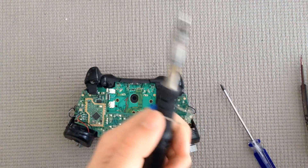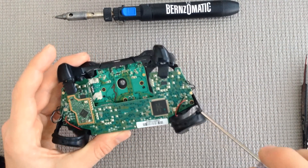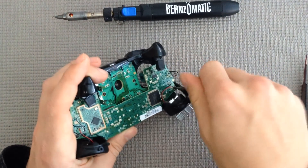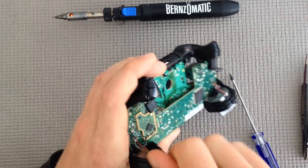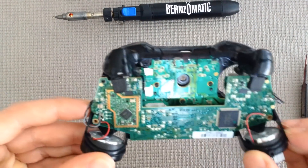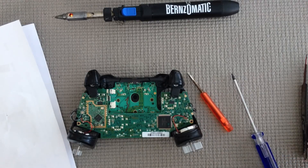So now we're going to go ahead and turn on our soldering iron and get that heated up. While that's heating up, I'm going to explain what's going to happen next. If you look there, you have two small screws — those are the T6 size. Go ahead and pop these two screws out with your T6. We have a total of eight wires soldered to this back. Before you start soldering them off, what's really helpful is if you make a note to yourself on where things go.